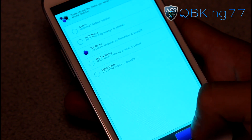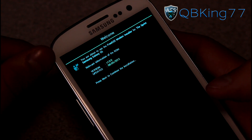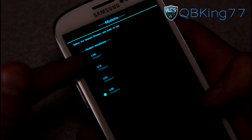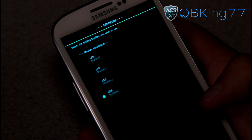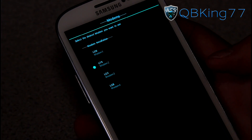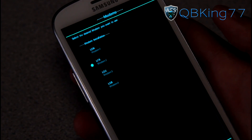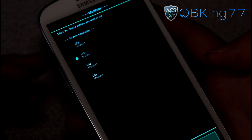I can do ICS theme — that's what I'm going to do. Hit Next, and now it says 'Welcome, you're about to use the modem installer — press Next to continue.' Hit Next again, and here we go. Now it asks which modem do you want to install. They're in order: the first one is LEN, next is LF9, next is LG2, and last is LG8. It's really up to you which one you want to install. I'm going to go ahead and install LF9 just for fun. Each phone handles each modem differently, keep that in mind.